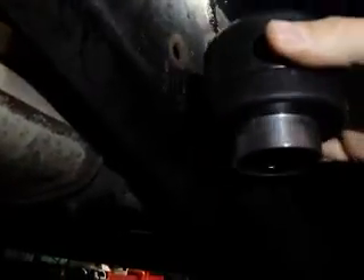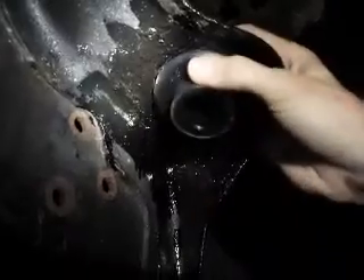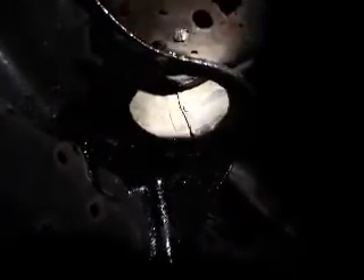Here's what we've got going on back here. Why is your cab mount sagging? You can see the water and moisture — here's my new upper bushing for comparison. Water and moisture gets on this surface and rusts away your frame bracket to the point where your cab upper bushing just passes through, obviously not providing much support anymore. So the back of your truck cab sags, and that's when you get body alignment issues and it looks like your frame's broken in the middle.